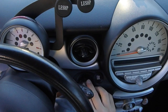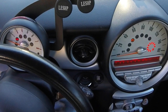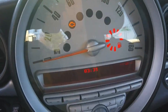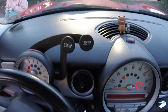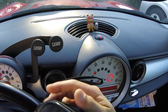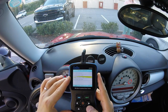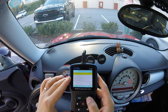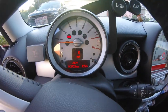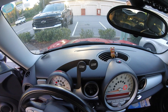Let's try to start the engine up. The idling sounds pretty good and stable, but I still see some engine warning lights — like here and here. It seems like the warning light is not going to go away automatically, so I probably need to connect a scanner for the Mini Cooper to clear those error codes. And it says the fault codes are erased. Now as you can see, those warning lights are gone. Hopefully this will not pop up again — I'm not 100% sure this can fix all the problems, but at least we gave it a try. Thank you for watching, see you guys, enjoy the Mini!